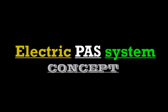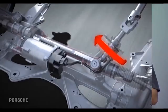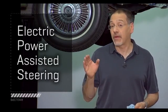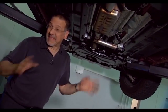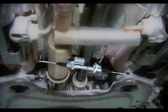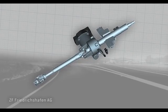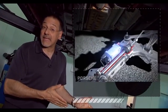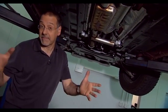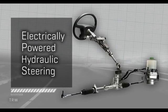These days power steering has changed dramatically. Welcome to the era of EPAS — electric power assisted steering. Underneath this 2014 Jeep Cherokee we find a very different steering system. The electric motor sits on the steering rack, moving those arms and linkages that steer the wheels. Another design places the motor on the steering column toward the firewall. The electric motor and its electronics sense your effort on the wheel and add assistance in the same direction. There are also hybrid systems that remain hydraulic but replace the belt-driven pump with an electric one, though the bigger trend is to go fully electric.